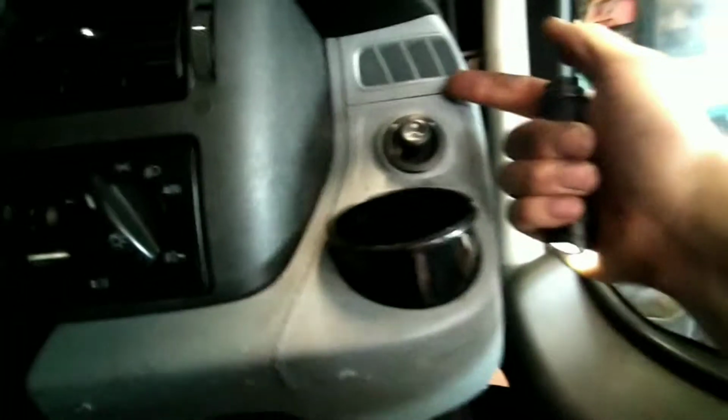So that's where the top mounts are. There's three 13 mil bolts holding the top mount in, and they're under that carpet. You can see, you just hack a hole in it, because if you don't, the trim actually comes up to the apron and it's all pegged in with clips. It's a nightmare. If you just throw a Stanley knife around it,